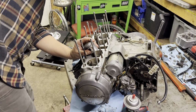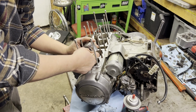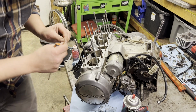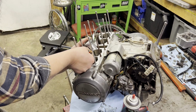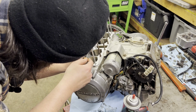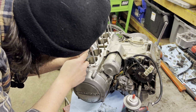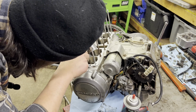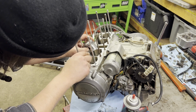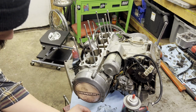So for this, I actually want a screwdriver. That's going to give me a little more leverage. Set one side into the snap ring groove. And these pistons are actually really nice in the sense they do have a little notch here. I keep constant pressure on this because I do not want to drop this in the motor. But get one side started. They're notched at the bottom, so there's your little pry mark. Pry that up, push in, make sure it's in the groove, and that's it.